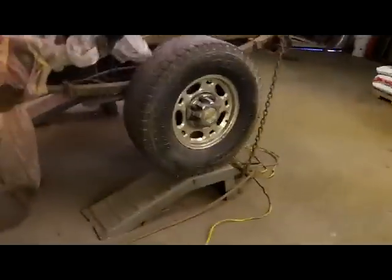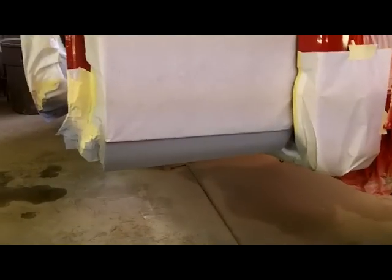You don't want to do that. I know it's dry to the touch, but the way I sprayed this primer, I started my furthest distance that I was going to prime and then work my way in toward the repair. That's the way that they suggest. Some people do it the other way and just keep building it out farther and farther.